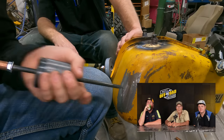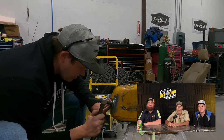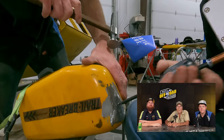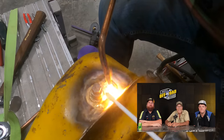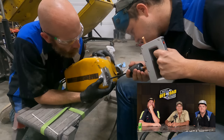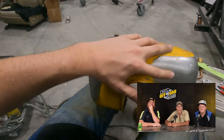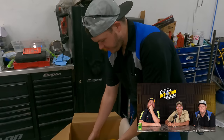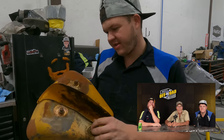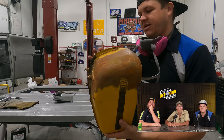Can you buy a new tank? I think they sell plastic ones now — we wanted to make sure you had your original. These are our two impact points — we're going to work those. We got this tank to seal. We're going to pressurize it and pull these dents out. Got all the dents pulled out of this thing. We went and had this acid dipped and they lined and sealed the inside of the gas tank. No leaks, nothing. I'm going to put some all-metal on this and make the outside dent disappear.